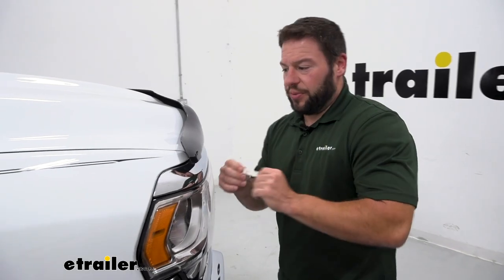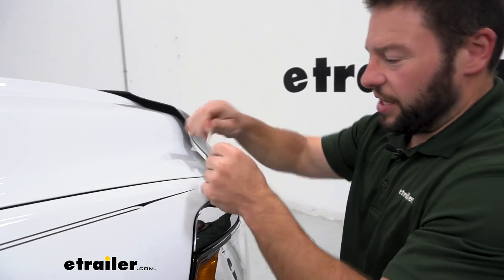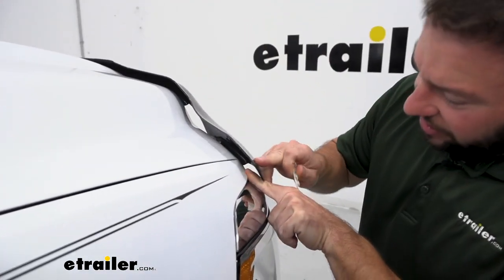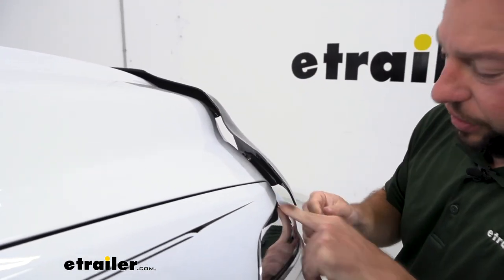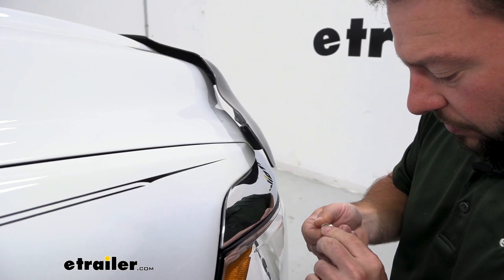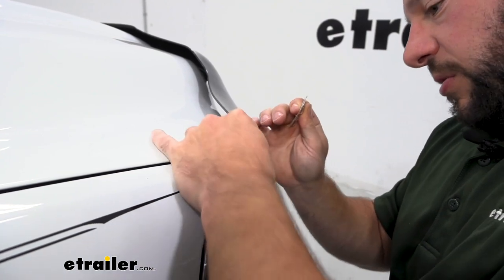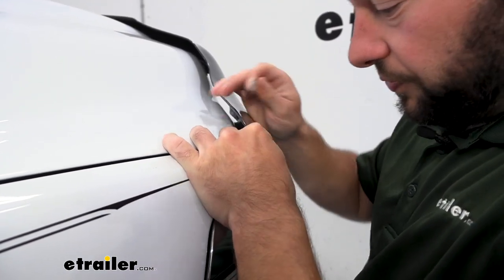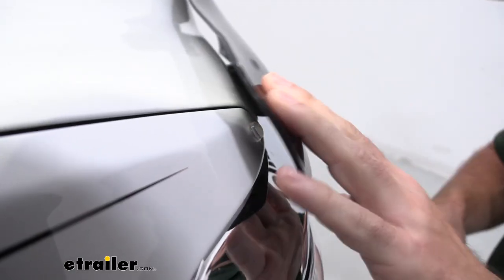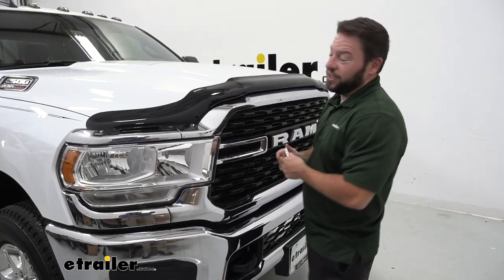Now we're going to install these stops on the hood of the truck. We'll go around and see where it comes close to the hood — that's where you install it, so that if it does flex a little bit, it's not going to be scratching the paint. It looks like this area comes the closest. Up on top it really doesn't get that close, so we're going to go on both ends. We've already cleaned off the area, so just peel back the stop and stick it in place — right here in the corner, because that's where it's the closest. Now we don't have to worry about it coming down and hitting the paint. We're going to repeat that for the other side and any other places where it looks like it's coming close.